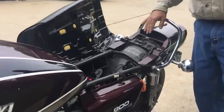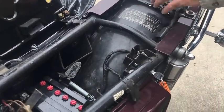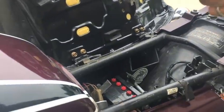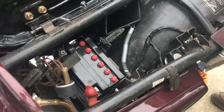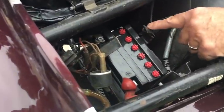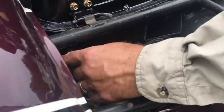Underneath here we don't have the documents or anything, but we're going to clean this up. We're going to replace these bolts with some replated stuff. This is kind of a weak spot on these fenders — see how this is busted? We're going to try to find another one. I didn't pull the side covers off yet, but for whatever reason we've got a spring here — I don't know if it's for a door or whatever, but I'm not so sure we like that. On my previous videos we've talked about how they've always tried to stuff a different battery in the KZ900A for some odd reason. This has been curled over and cut. We're going to try to fix this battery box and get rid of some of this wiring.